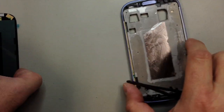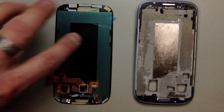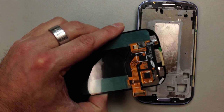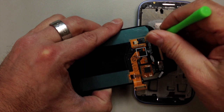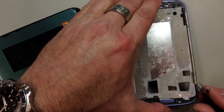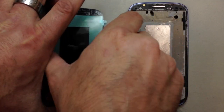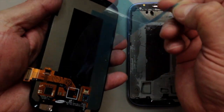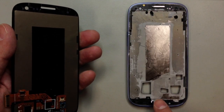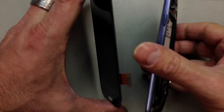Make sure your home button and your speaker mesh are there — you really only get one shot at this. You don't want to stick it in there and then have to try to take it off again; it's very sketchy as far as the odds of getting this thing off in one piece. So go ahead and remove the wax paper. You can see I've added adhesive along the bottom here, kind of just custom cut to fit. Unfortunately these things do not come with adhesive underneath the edges of the glass at the top and the bottom, and I do like to add that — it keeps the glass off the bare plastic surface and they do tend to peel up a little bit at the bottom, especially on the right hand side for some reason. The wax paper I just peeled off was from the factory adhesive that's on the back of the AMOLED.